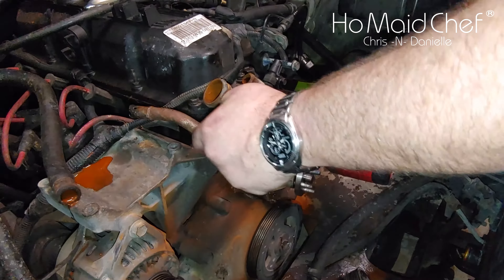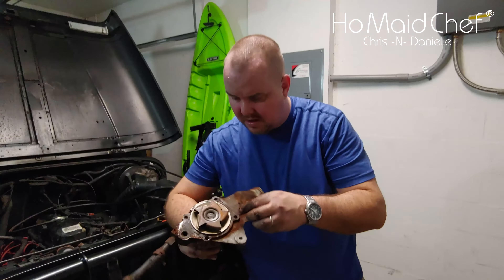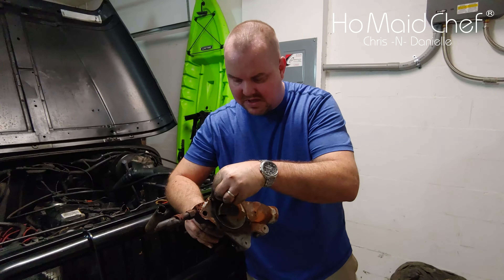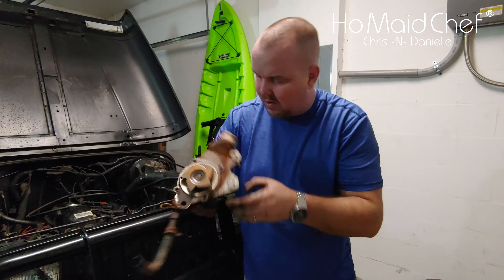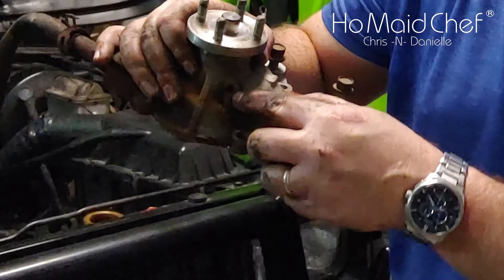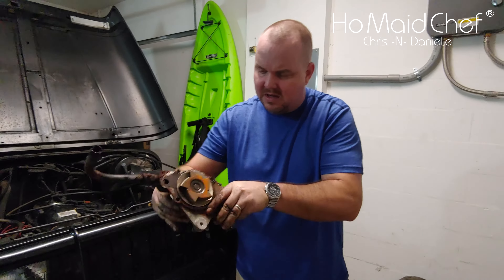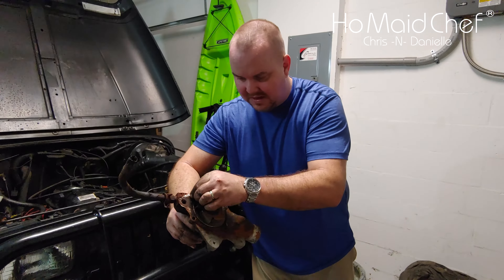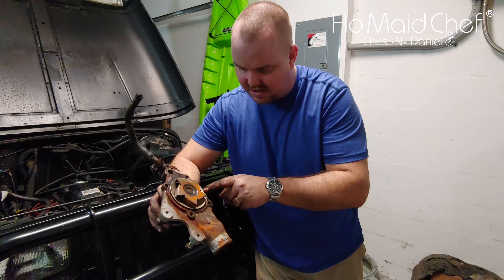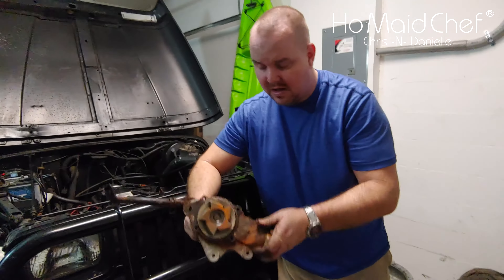There we go — water pump is out. Look at that. The impeller actually doesn't look that bad. I'm wondering if the gasket was blown out. When I pulled this thing off it looks like somebody just used gasket material to put it on. I don't see anywhere water came in from the weep hole, and the bearings don't feel bad either. So I think we're just going to get a new gasket, put it in, stick it all back together, and see if it leaks. But yeah, it was leaking a lot of water and that was not under pressure — it shouldn't leak from the weep hole either. Hopefully it all works.